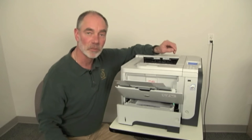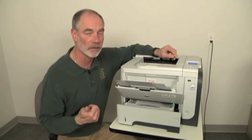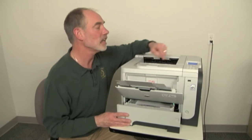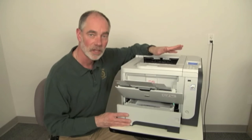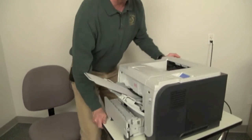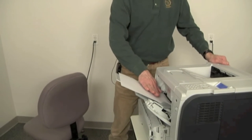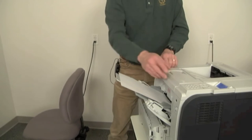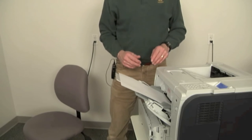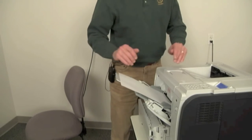When I tell it to run a test, the machine is going to say it has paper on tray one and grab that first, or it may ask if I want to use the paper on tray one even though tray two is open. I press the button and away it goes. The idea is I want to run the paper about three quarters of the way through and then pop open the door so I can take a look at the image inside. When I see the paper feed, I know how far it's gone in. Depending on the paper path, you may want to wait until just after it's gone inside, or stop it sooner.